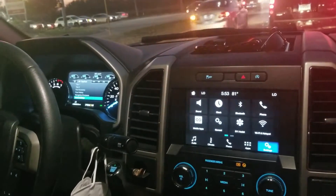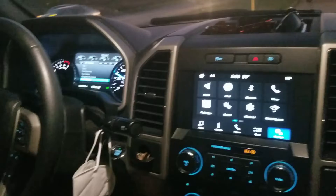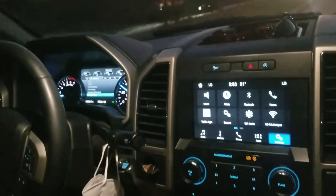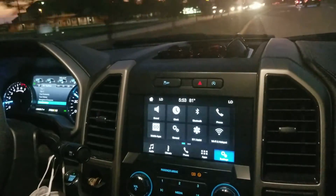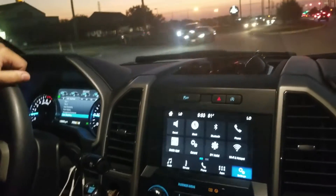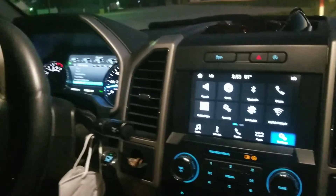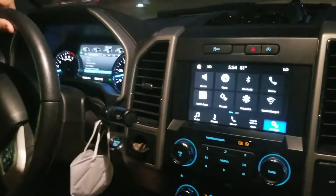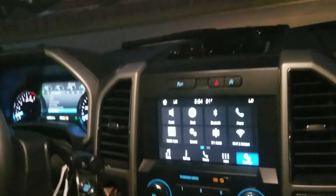I don't know if it'll turn off again after that — I haven't waited that long. There are a couple of things I've heard: if your car is turning off for about six seconds you're automatically saving gas. The initial startup of a car or truck, especially a V8, maybe seven or eight seconds — it uses up a little more gas than when you're just cruising or on idle. But the other concern is the usage of that starter.